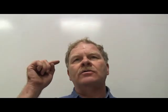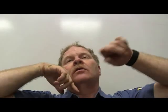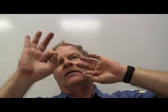Let's look at the voltage at the last common circuit point. We're going to follow that from the fuse to wherever all of this stuff's not working. You go to the place where that branches out and goes to all of them, and I'm going to see if I've got voltage right there. If I've got voltage there, then one of those legs is going dark on me, basically. If there's no voltage at that point, you work backwards on that. But anyway. Number 40 lists the three types of sending units and define their purposes.